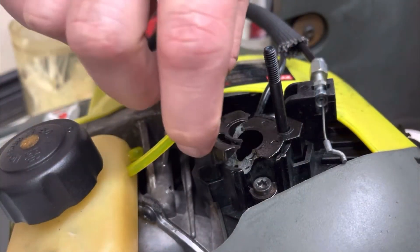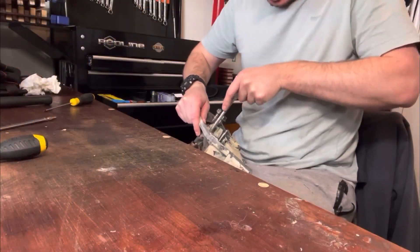Of course not just flexing it, we can damage things. I damaged a manifold a little while ago, I cracked a flywheel — so stupid, I should never have done it, and yet it's just getting complacent in the process. Most of the hardware we're working on with small engines is M4, M5, M6, sometimes a little bit more. Most of that hardware needs to be just snug and then one eighth of a turn more — that's all you need. If you find certain circumstances where bolts are backing out, use a little bit of Loctite, but I can almost guarantee you are causing so much more damage by over-tightening rather than under-tightening hardware.